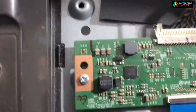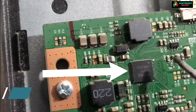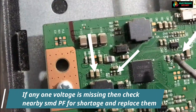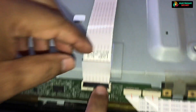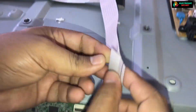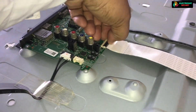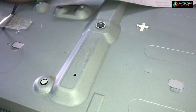If the DC-to-DC voltages are not present, then you have to replace the DC-to-DC IC. If any one of the voltages is missing, then check nearby SMD capacitors for any shorts. If you find one, replace it. Now if all the voltages are present and there is no abnormality in the scalar PCB or T-con, and all the values are good, then detach all the LVDS or FPC cables from the scalar PCB and mainboard, and clean them with a cleaning solvent like thinner.